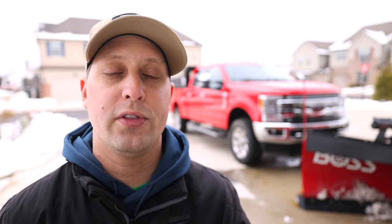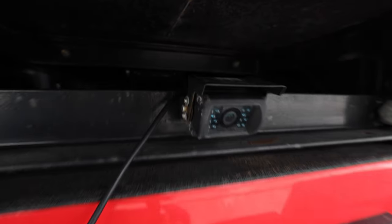One other question we get all the time is about the rear backup camera since we took off the tailgate for the dump insert. We used an extra camera from Camera Source, which is actually an affiliate partner — use code Brian10 to save some money. What we did was mount the rear backup camera on the undercarriage of the dump insert, and those AV cables just literally connected to the old AV cable from the tailgate. So we can still use the rear backup camera from the in-dash screen and we didn't have to get an extra monitor or mount something onto the dash.